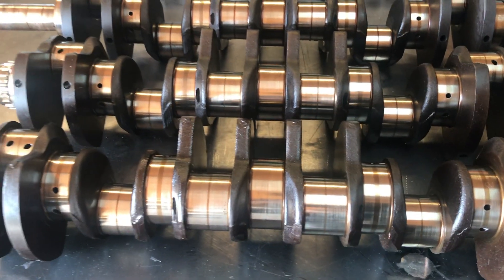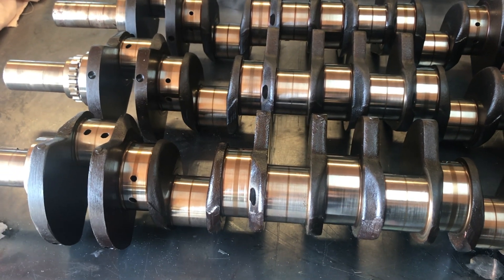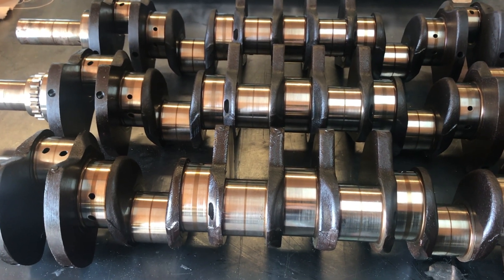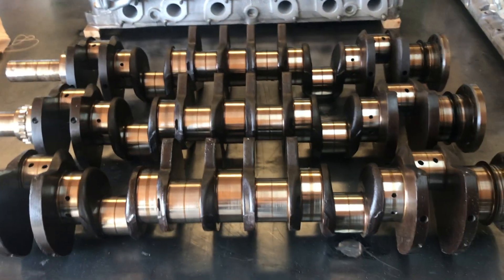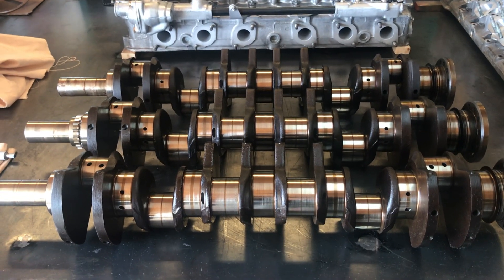That's why it's so hard to get undersized bearings for these things today. Eventually Jaguar said nobody grinds any crankshafts — you've got to either buy a good used one or buy a new one from them. At that point, all the manufacturers stopped making undersized bearings, except for ten-thousandths. You can still get those. So anyway, bench full of crankshafts, and only one of them made the cut.